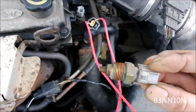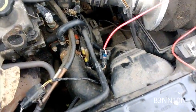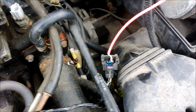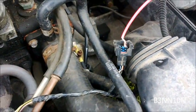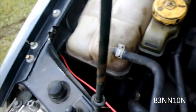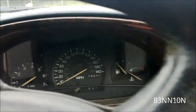I just want to show you the second cheat, and this is for the sender which controls the gauge inside the car. Unclip it — as you can see it's located way down there — unclip it into the hole and ground it to the body of the car, so basically you're shorting it out. Then turn the ignition on.